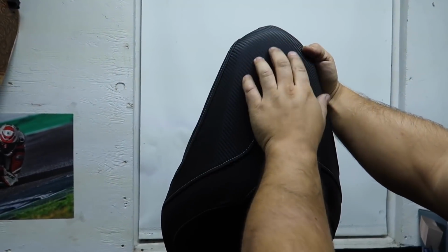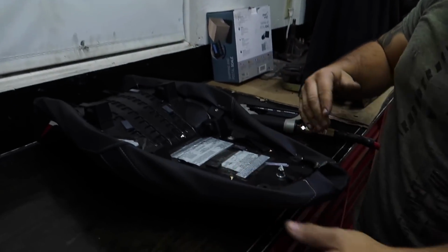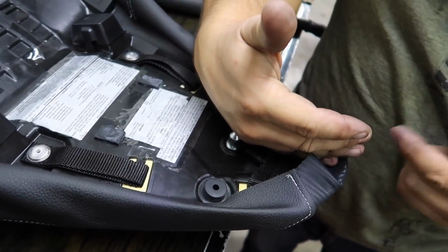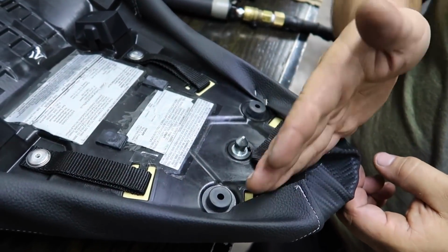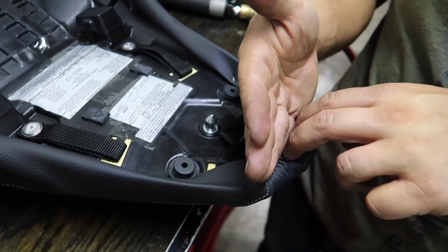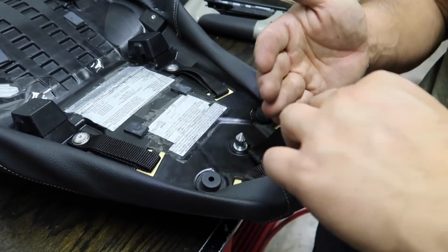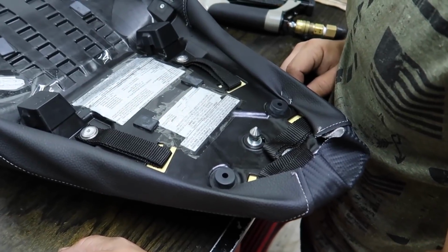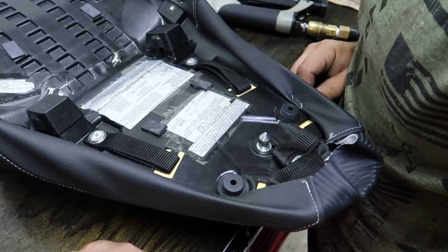And then you staple everything in the rear. Also, when you're stapling, if you're stretching this way, don't put the staple straight; it'll rip out. You want to either go at an angle or go this way. That way, the staple's holding this way and not this way. That makes sense. That's one word of advice. We're going to keep firing staples into this, stretching it.